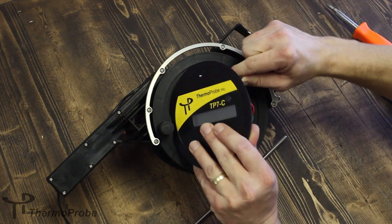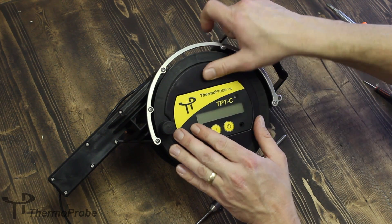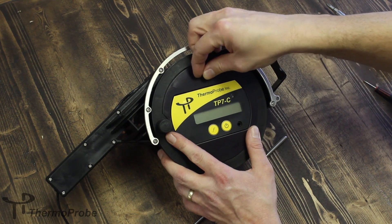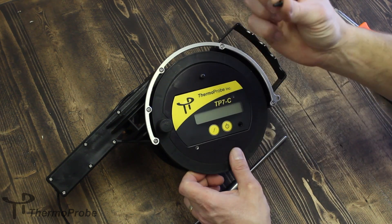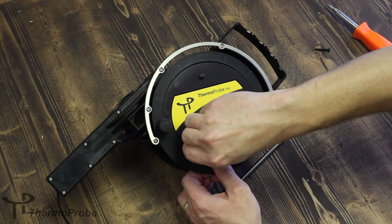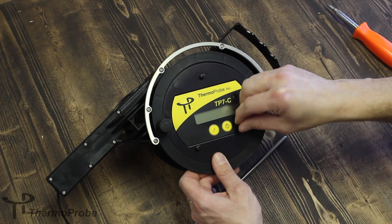Be careful that your cable does not become pinched in the process, as it won't allow the faceplate to be installed correctly. You have to reinstall your three screws. Two screws are shorter than the other and go on the left-most two positions. The lower right-hand corner takes a long screw that goes inside the instrument overlay.